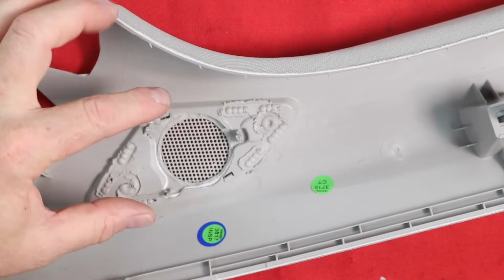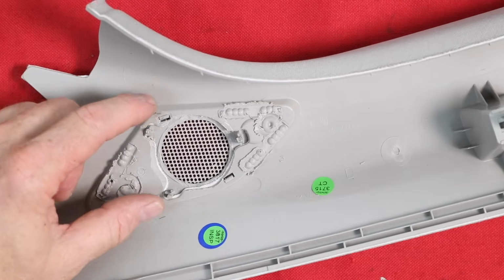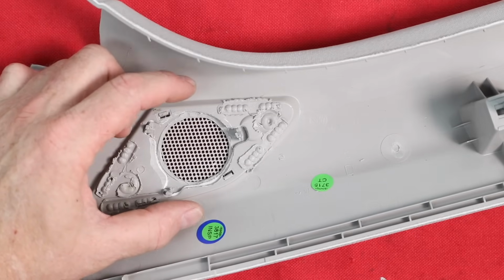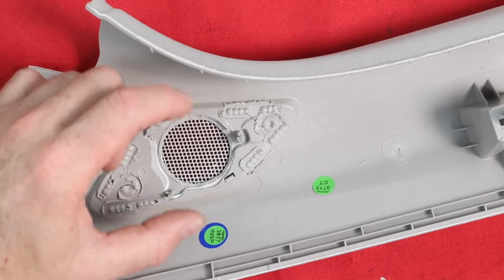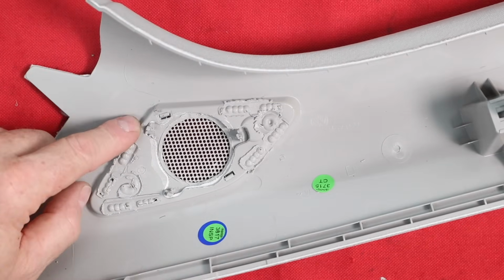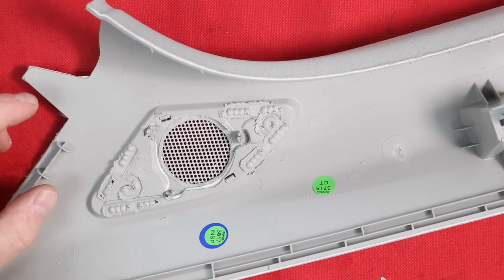The idea is that because it is the lab, we are gonna be changing the tweeter out from time to time. So we found the biggest tweeter that we could that is gonna go in this location. I mean, we can't go too big because it has to be within these points. So we looked and we figured, okay, it needs to be so big. Then we figured out, okay, so how do we attach to here, and how are we gonna make it so that we can swap in and out tweeters when we need to?